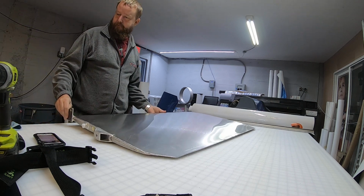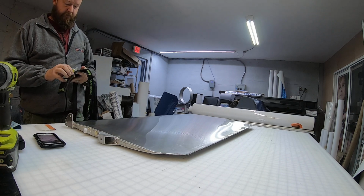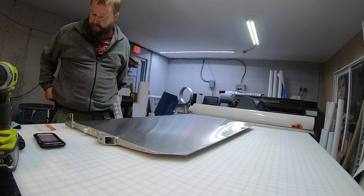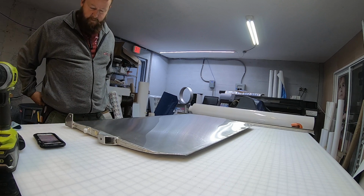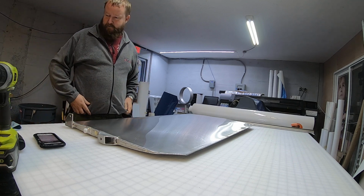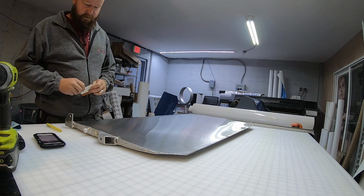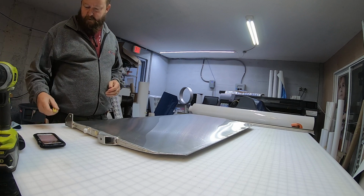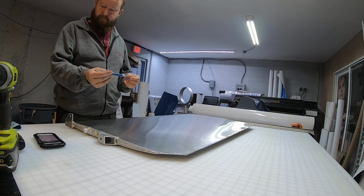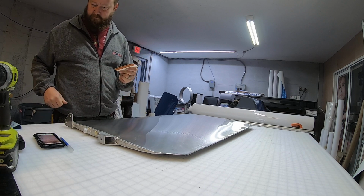Alright, so we're going to give that a minute to dry. But you can go over a couple things that you want to make sure you have. I usually use a little belt that keeps all my stuff locally. I have a problem with tending. It's been very difficult to get used to using the belt and always putting things back in the pouch, so you know where it's at every time. Developing that habit has been difficult for me. I always want to try and stick stuff in my pocket, and then I start to try and check which pocket I have everything in, and I go all over the place trying to find it. But primary things you need are a knife and your squeegee. After you've laid it and you need to check, if you've got some air bubbles, you've got an air release tool that will help you remove air bubbles. Sorry, I'm looking at my phone and not the camera, so once again, squeegee with a felt edge.